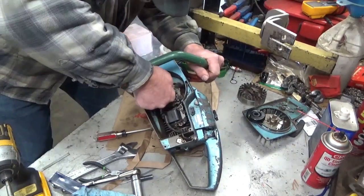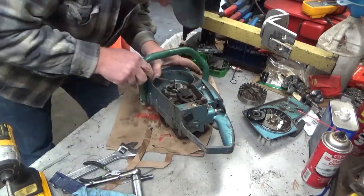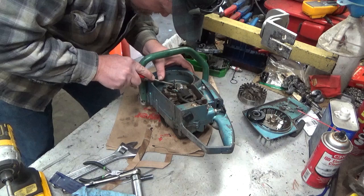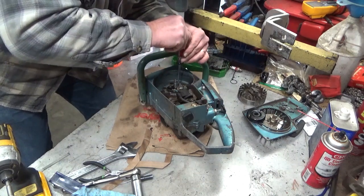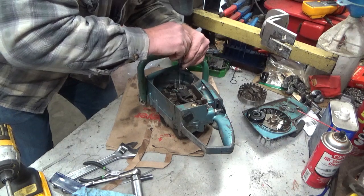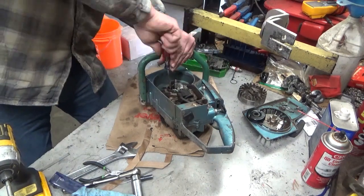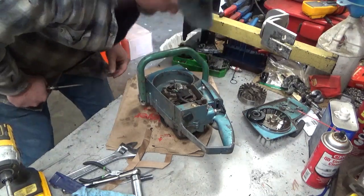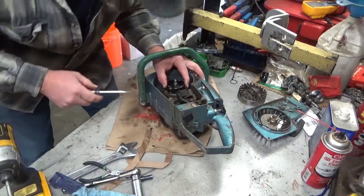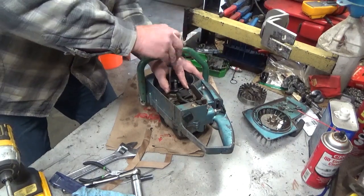Alright. Get this to the top of the crank lobe there. Center gap. Gap is set at 0.015, which typically is done with a feeler gauge. I'm eyeballing this, and I know I have it right, but basically I want to get this together without consuming too much video time and test it. Capture that points lead under the cover here so it doesn't get jacked up.